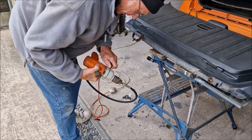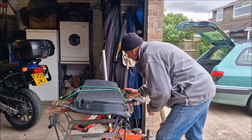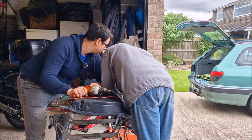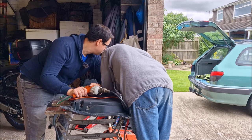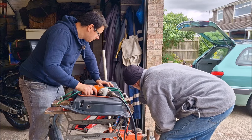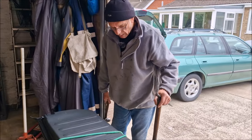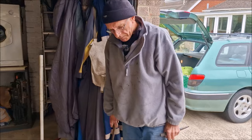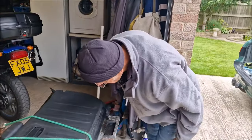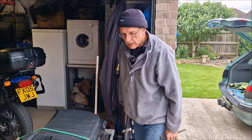What's that you've got there? It's a drill with a drill bit attachment on there. We're trying to drill it out but it's going off centre. We've tried to drill it out and tap it out with a punch - it's stuck solid, it's not coming out at all. We've brushed the end off and actually we've broken that end off. The new plan, which seems to be the accepted solution on the smart car forums, is to drill the pin in about two or three centimetres, tap it out, and then put some Allen bolts in the new hinge. There's no way we're getting those pins out.